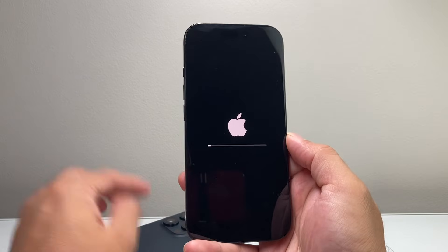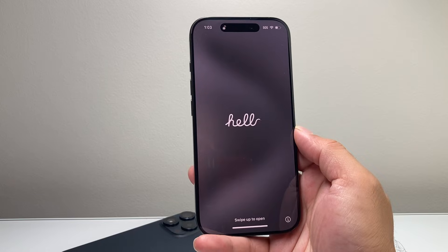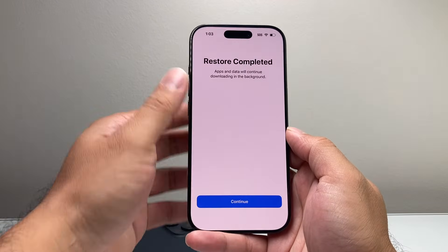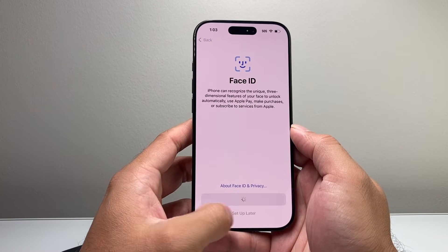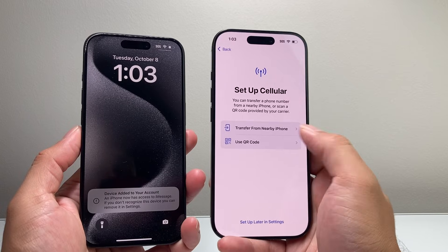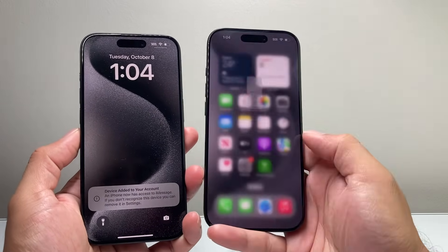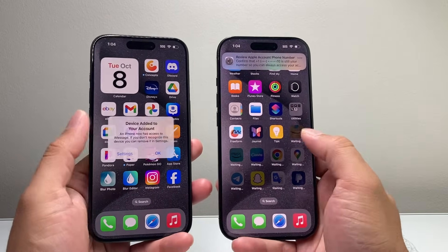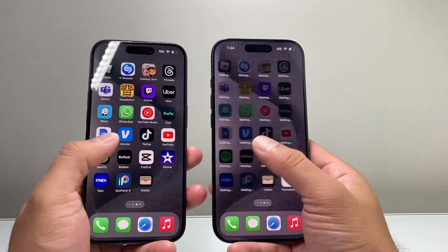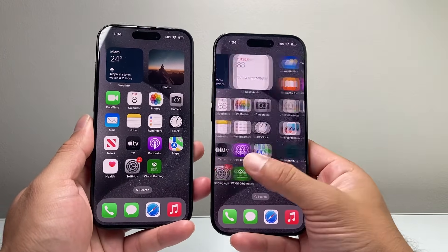On the new iPhone it's loading, so we'll just wait — this will take some time, so you have to be patient. The data transfer has completed. I'm going to load it up by swiping up. The restore has been completed — hit continue and set up Face ID if you haven't. Then cellular: if you want to move your cellular data, you can either bring your other phone to do a transfer or use a QR code. I'm skipping that because I don't have cellular set up on this phone. Then Siri, and now we're on the phone. Everything has been moved over — all the apps are downloading on the new iPhone just like my old iPhone, same with photos and videos. It does take some time, so if you don't see it right away, just wait as it completes.